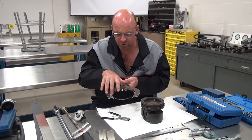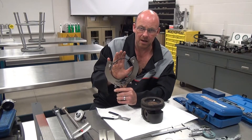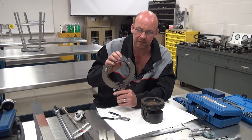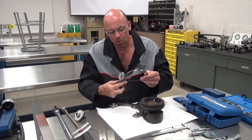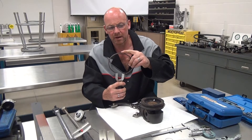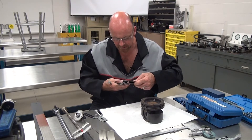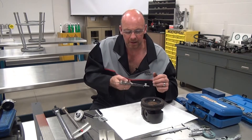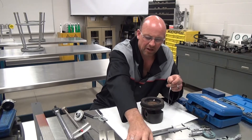It's called a full-circle type because it allows pressure to be put on basically four points on the ring so that you can expand it. I'm over-expanding this ring just to show you how effective this tool is by holding it at four points to open it, as opposed to holding the ring and opening it at just two points. You can see that gripping at four points evenly opens up the ring, so it has less stress on it when installed onto the piston.